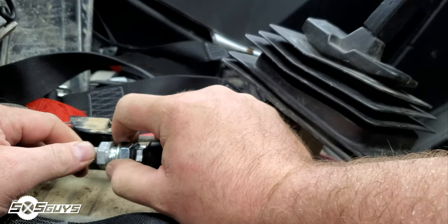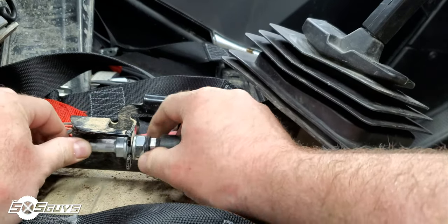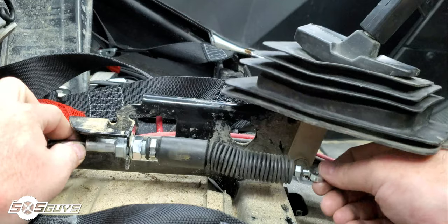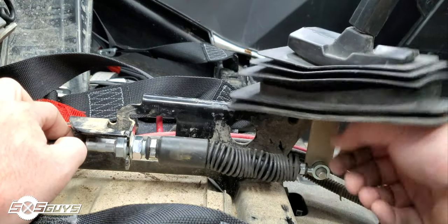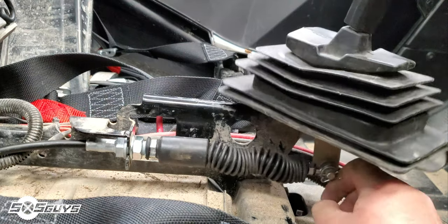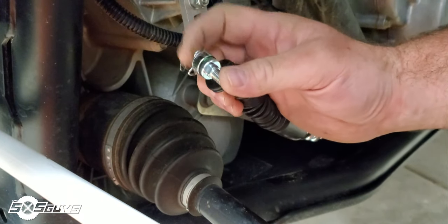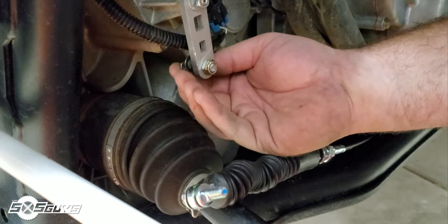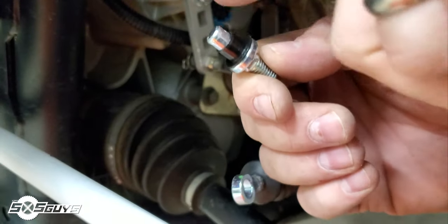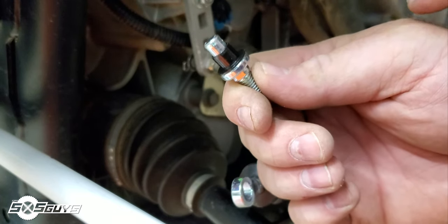You'll see that on the threads there's a flat spot, and that goes into the metal bracket just like that. Since this is the non-adjustment side, just tighten it down and reconnect it — make sure you've got your bushing and your washer on there. Before you mount your new cable, they come with a new bolt and clip. If you left the old hardware on and it's fine, you can take the new hardware off and keep it as a spare. On the pins that come with a plastic bushing, if yours is deteriorated or cracking, go ahead and use the new one.